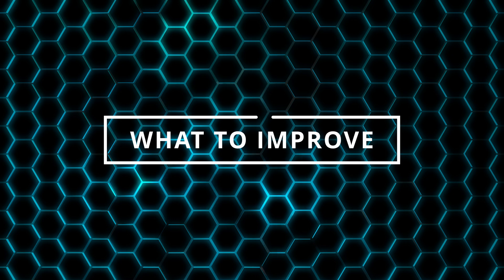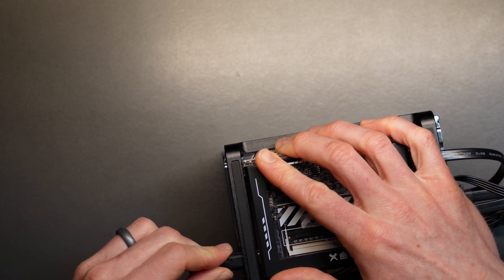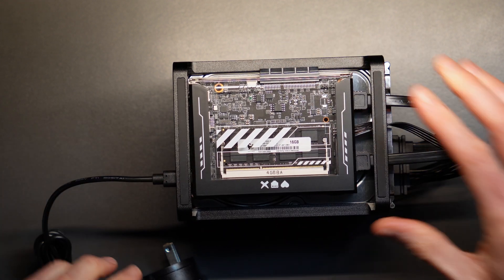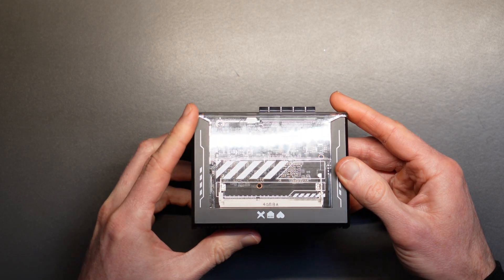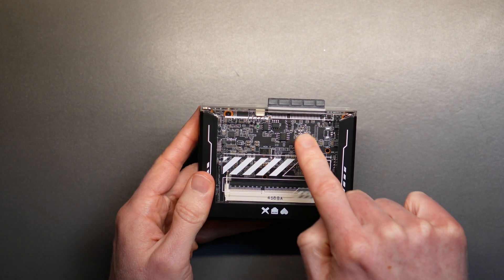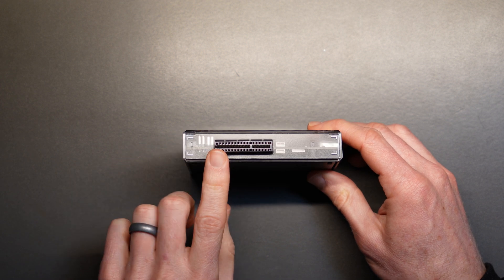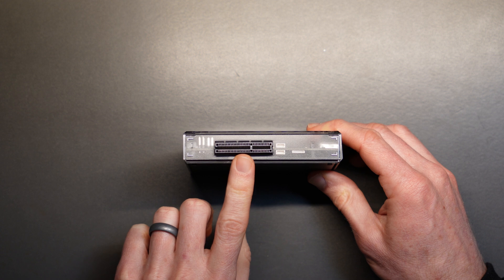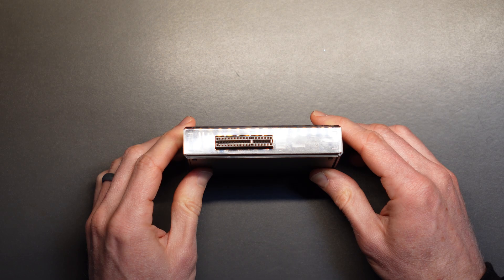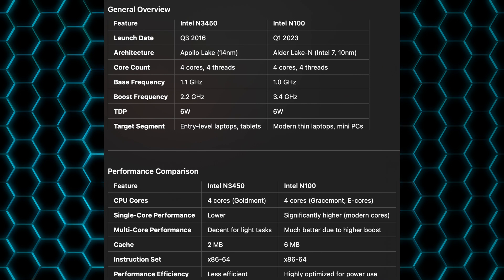It's a sleek mini PC, but it's not perfect. There are four things I wish were different, starting with the power supply. Since it uses USB-C, you might think you can use your own, but probably not — this uses 12V, which is not as widely supported as 5V. So even though it's USB-C, you'll need to use their power supply, which feels more like using a barrel connector. Second is related to powering up and down: there is no externally accessible physical power button, and the LED for power is on the bottom of the board so you can't see it. Third, the PCIe setup could be a bit more thoughtful — anything you plug in is just kind of hanging out there without some kind of shelf, especially when the Zima Blade is sitting atop the NAS rack tray. Last, this is using the older Apollo Lake family released in 2016, instead of the newer Alder Lake or N100, meaning it has lower performance and may be less power efficient — but that's reflected in the lower price.